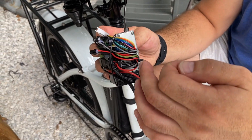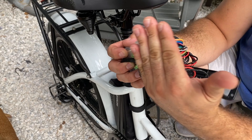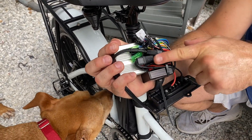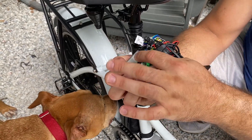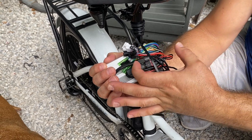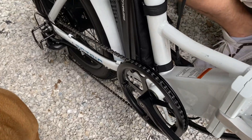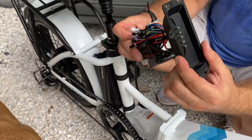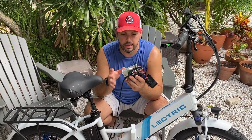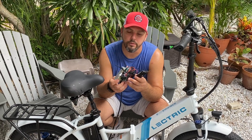When you slip it in, you will slip in the controller afterwards, and make sure the controller has the wiring on the side. Once you're done with that, you're going to want to take your adapters and just push them down the side. This will be drawn in from the back — pull it out the front and connect it, then just pull it back through your slack space in the housing underneath. So it looks like that. These are the best hookups I've found with both bikes, and this setup did work with the step-through 1.0, version one.